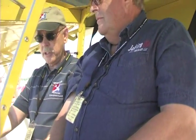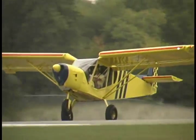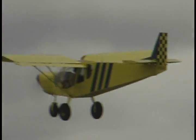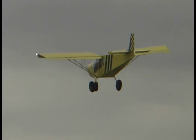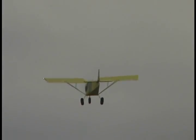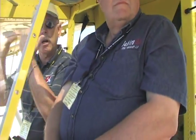With this engine, this airplane probably has a takeoff roll of somewhere in the neighborhood of 150 to 200 feet. Based on the numbers we have for our POH — which we'll refine with our own testing — it's about 360 to 370 feet over a 50-foot obstacle. So it'll get you out of a very short field quite easily, and the landing is equally short. That has to do with these slots on the front of the wing that allow air to flow in a controlled manner so it hugs the top of the wing — that's the whole STOL characteristic that has made this airplane a real delicious choice.